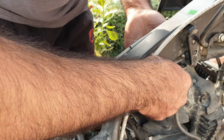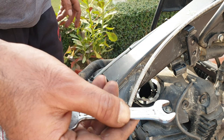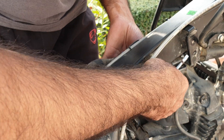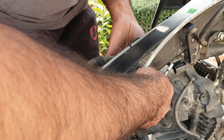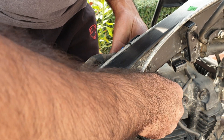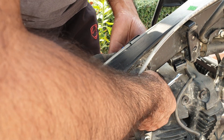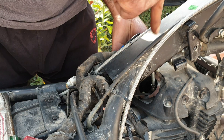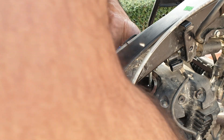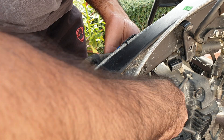This feels comfortable. I'll hold it like this, use the 10mm spanner, and just make sure you hold it here only, keep moving this underneath so that you feel that drag. First tighten the screw by hand as much as I can. Now holding this in place I'll tighten it. The idea is to apply pressure on the tappet nut holder in the opposite direction — anti-clockwise — while tightening the nut underneath clockwise, so that it doesn't move out of spec.